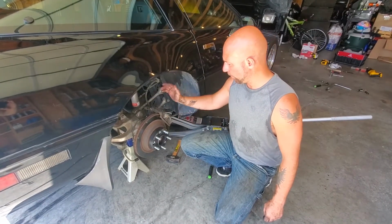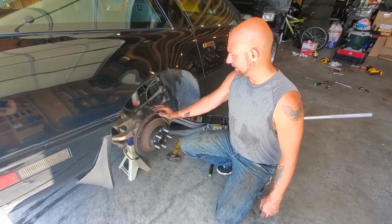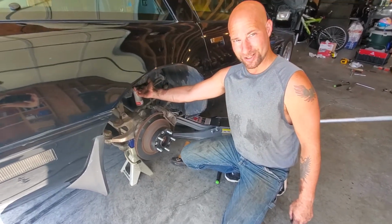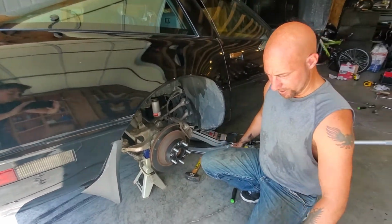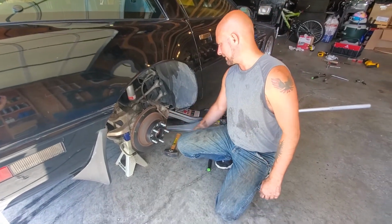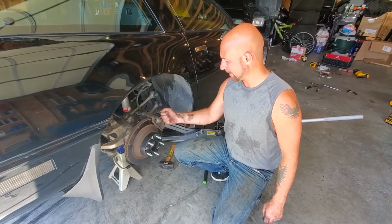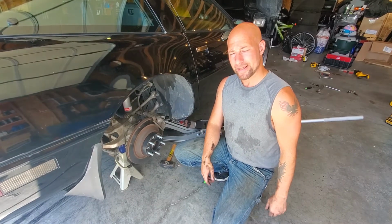So thanks for watching. I hope it was helpful to you, with the exception of not being able to get that back shock back on. But all you've got to do is, assuming that you have the bolts that aren't broken off, put those two bolts back in the same way they came out, and you put your 21 millimeter nut on the back side. Torque that up to 19 pound-feet on the back, and throw your tire back on, and you are good to go. Boom! Thanks for watching this.